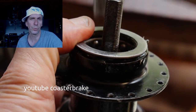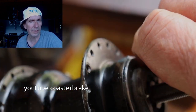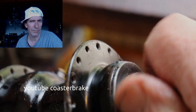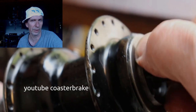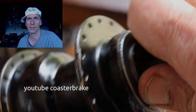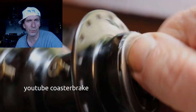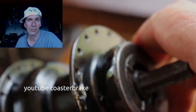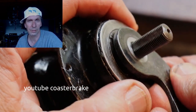The problem of every three-speed hub is if you have Vaseline and yellow grease and oil in a hub, after 2 or 3 years you only have oil in it, and it is better to refurb a much used hub every year, and work on the play of the ball bearings.